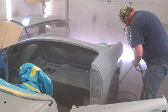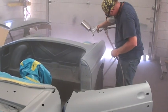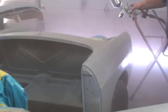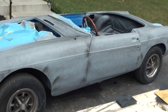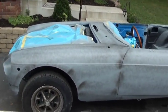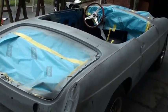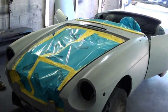I'm putting the second coat of primer on and he's going to put a total of three on it. We got the car back from Grant. The primer set for a day to let it harden up really good. We took a little bit of black flat paint and sprayed all over the car — the reason being it'll help you sort out the spots you miss when you go to block it out. Right now it's looking fairly decent. We'll go ahead and start blocking it out with 400 grit.